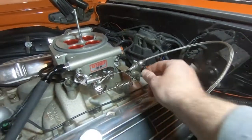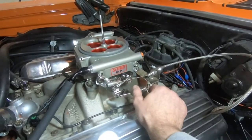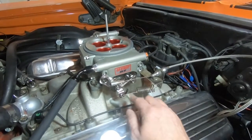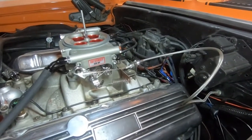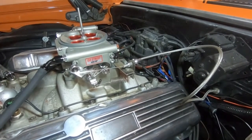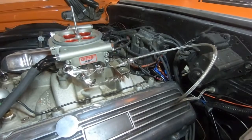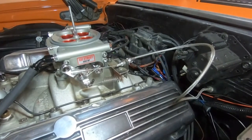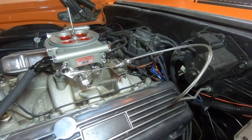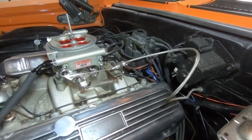We're going to move this plate back so it's more of a straight shot, might even move it in here. We want to keep the spring tight. If we have to, we'll re-bend the spring and take a half inch out - that shouldn't be a big deal. If we screw it up we'll have to buy a cable, not a huge deal. As it sits right now it isn't safe - it could bind and stick with the throttle wide open. I tried the local parts stores and couldn't find one; I only need an 18 to 24 inch cable but everybody's got a three-footer.